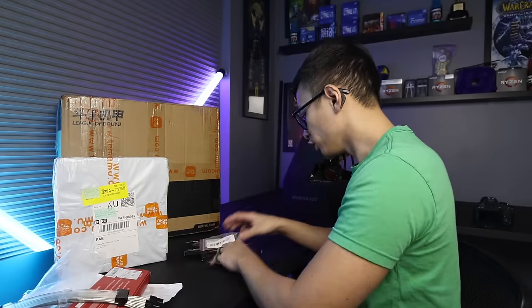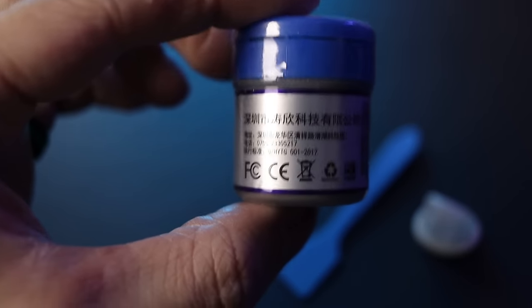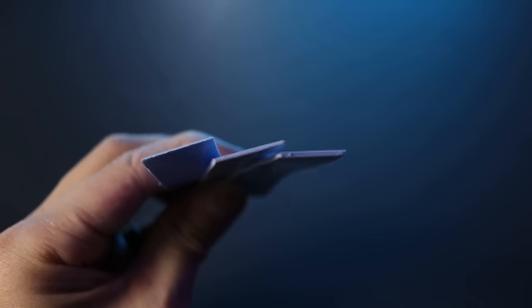I also bought some pretty basic stuff: a multi-set of thermal pads — silicone thermal pads you'd use on graphics cards of variable thicknesses — and some thermal paste that comes in a little jar. This is thermal grease Y5810, comes with a little spreader, and it was two bucks. No weight or volume information on here, but this should easily last 30 plus applications. For the thermal pads, there are 12 pieces — four pieces each of half a millimeter, one millimeter, and 1.5 millimeters. I just wanted to buy these to see if quality was any better or worse than stuff from Amazon, Newegg, or AliExpress. And it's the same thing.